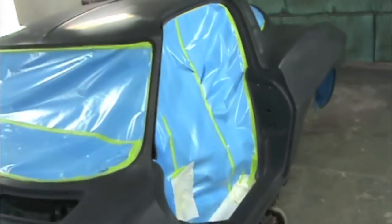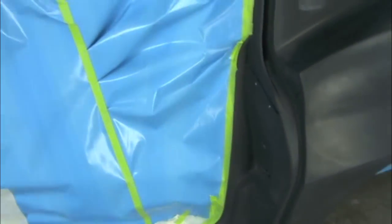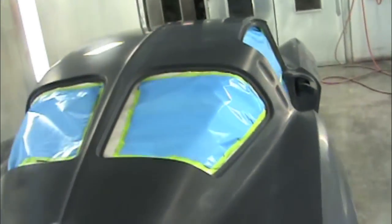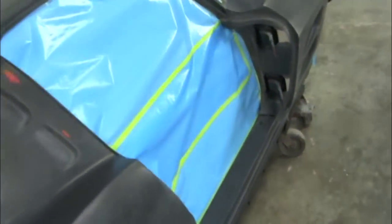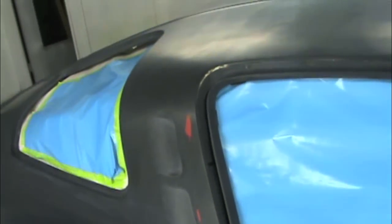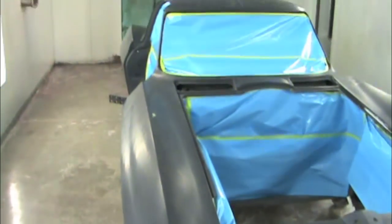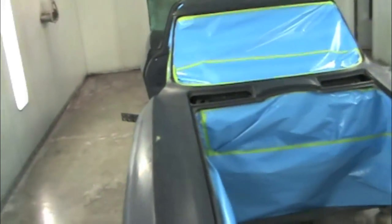If you don't polish it, it actually dulls up. This '63 Corvette is going to be judged on paint standards, so we're going to be spraying it with lacquer. It's going to have bare fiberglass behind the door hinges — we're trying to duplicate exactly what the factory had, all the way down to having the proper red oxide primer and overspray in certain spots. By using lacquer we'll be able to polish the outside in a manner that completely and accurately represents the way they would have done it in the factory.